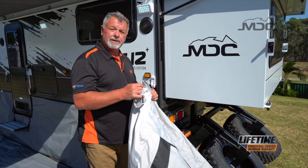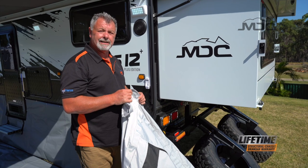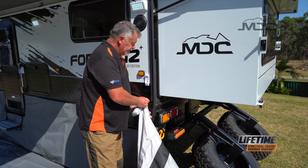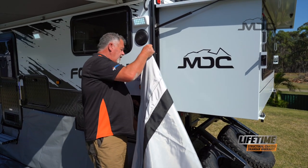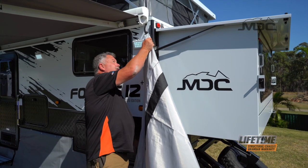Now that my floor is laid out, I'm using the end wall at the back of the caravan and sliding it into the sail track, which is located just before the end here. We thread our insert in and carefully guide it up the sail track, making sure it feeds smoothly, doesn't catch and doesn't tear.